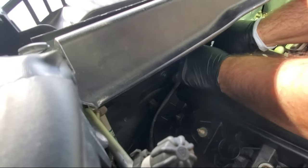Now take these little gaskets off from around the bolt holes on the valve cover. Use a flathead to pry them up — they could fall into the engine if you're not careful. These gaskets are almost plastic-hard, not rubber anymore, which is bad. It's best to get a kit that includes all of these and replace them all. The four middle bolt holes also have gaskets — pry those up as well. If they look brittle or have white residue, they definitely need replacing.